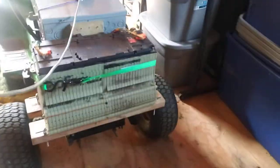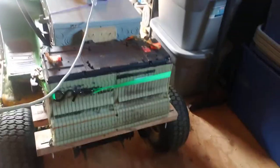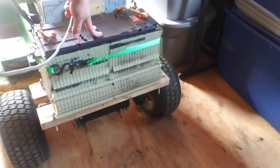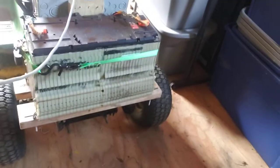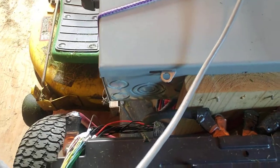What I did is I took my two batteries and recombined them into one Chevy Volt Master Module here. This is the equivalent of what would have been 96 volts of power, but because of the way I've wired it, these are wired in parallel. So there are still 48-volt modules wired together, giving me — what is it — maybe 200 amp hours, or 50 amp hours per module, 100 total. The wires are located right here. It's not the cleanest but it's a lot safer than it used to be.